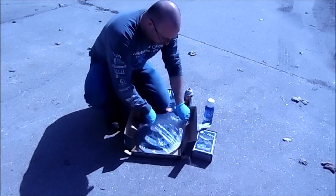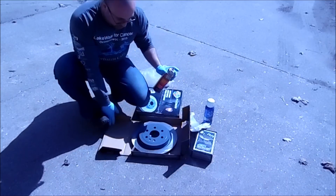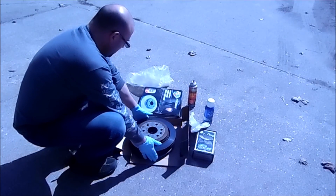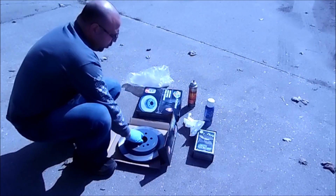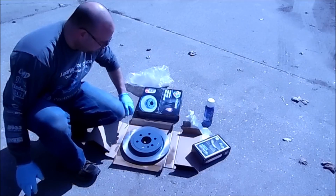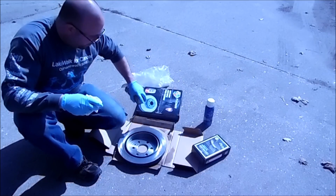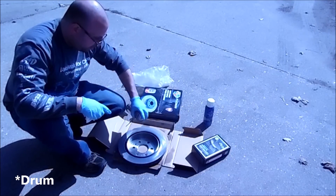We're going to open up the rotor packaging and pull it out. What you want to do is throw a little bit of brake parts cleaner on it — just a little spray. One thing I should double-check before doing this is that this is the same rotor as the other one. Yep, exact same rotor. The reason you do that beforehand is because once you clean them, sometimes you can't return them. They ship rotors with oil on the surfaces just to make sure they don't rust before you get them. Since this one has an inside shoe parking brake, just get a little bit in there as well.